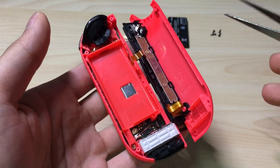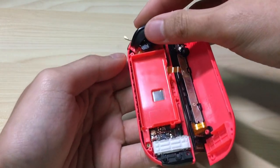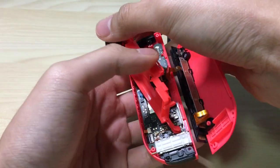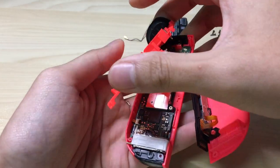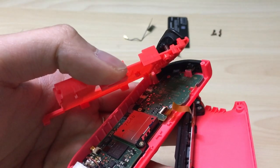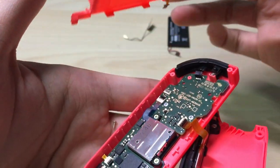So with all this disconnected, now you can proceed with the Phillips head screwdriver and disconnect these three screws. You will be able to disconnect the middle bar. But be careful — there is a small ribbon cable. You'll need to put it slightly up like that, and you will need to disconnect this cable over here which I almost tore already. Disconnect that cable, get it up, and now pull this out and disconnect the middle part altogether.